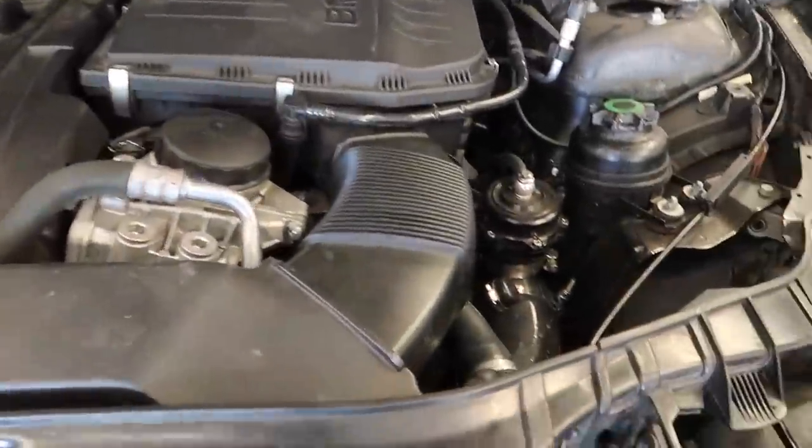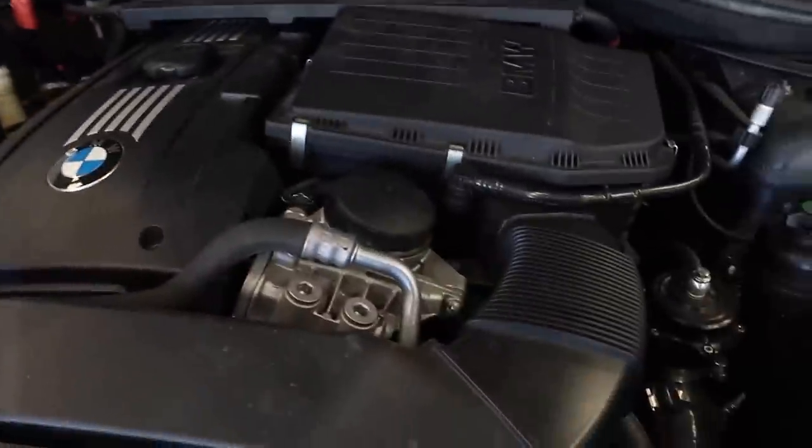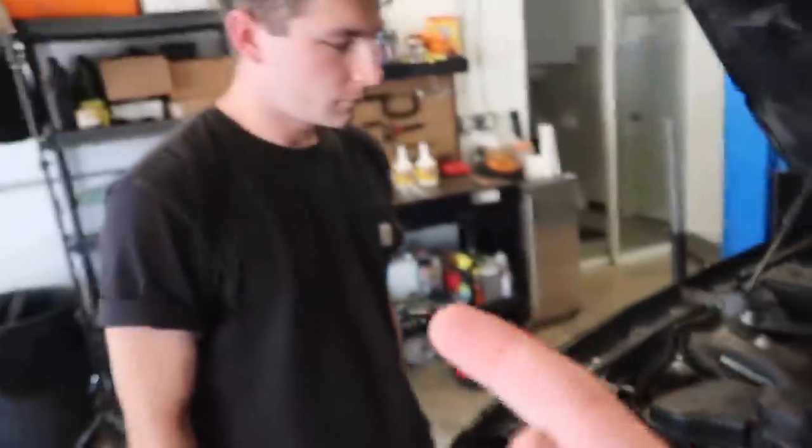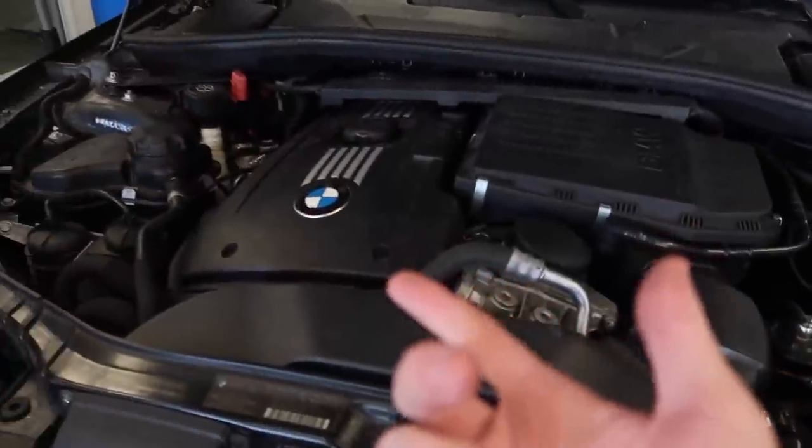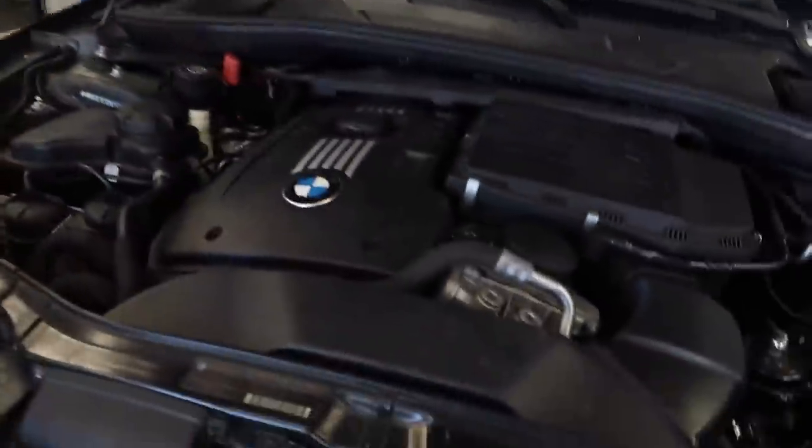So literally every single gasket has been done now, except for like the head cover gasket, which I don't think... I mean, that's when the engine's blown. That never happens really on these. So that's actually perfect. You did the spark plugs and ignition coils, right? Correct. But they're not a step colder, they're just the regular performance ones. Okay, so you might need to upgrade those down the road, but for now, we'll run it till it misfires. The good Delphi ignition coils, the metal ones. So we just need upgraded spark plugs. These are cheap anyways, maybe $150 for an upgraded kit.